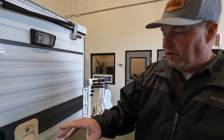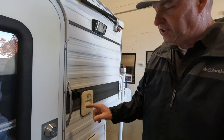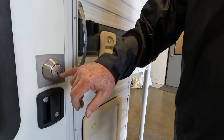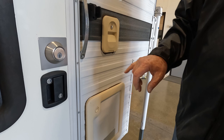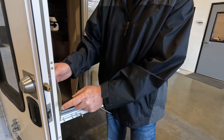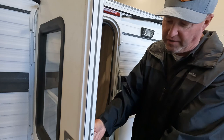The rear door lock is a more common maintenance item. Other than washing it, about once a year spray some graphite or lock grease in here — you can get it from a hardware store, Walmart, or Amazon. Keep these little lock cores greased up, whether it's a water filler or a cassette door, but definitely your door handle and your deadbolt. Take the deadbolts and squirt some grease in, move them back and forth a few times to get it flowing nice and smooth.